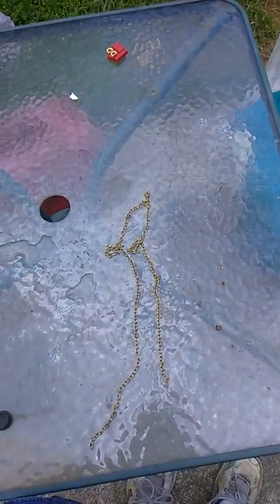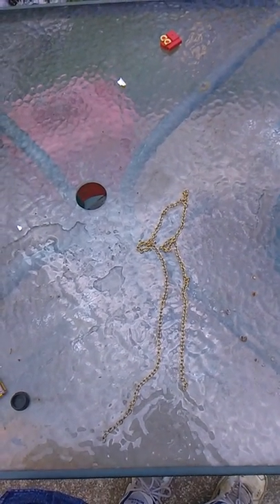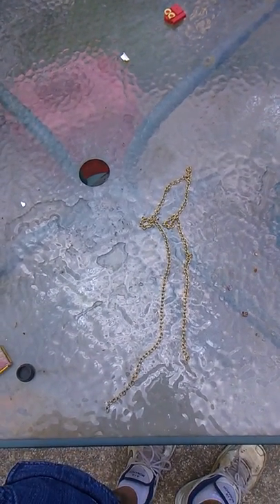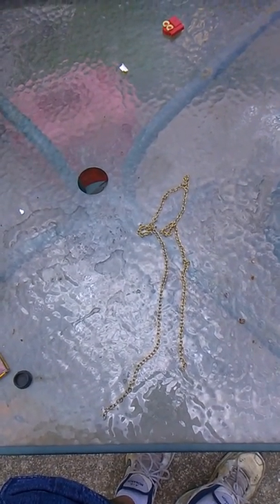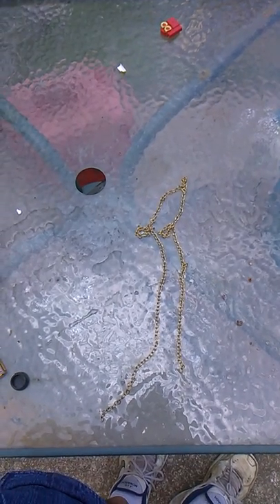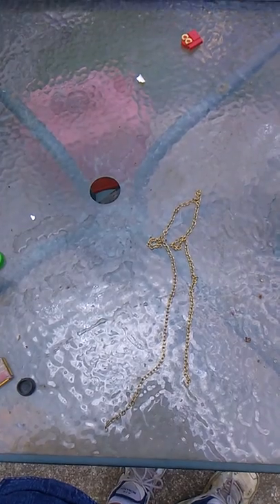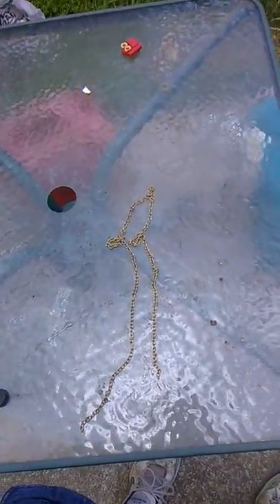When you think you've got it all done, put some gas in there, seal it up, shake it all around to rinse the inside, then pour it back out through the petcock opening into a funnel with a white rag or cloth. That'll grab any dust particles or rust, and do it again until it comes out clear — you'll know when it's good and when it's bad.